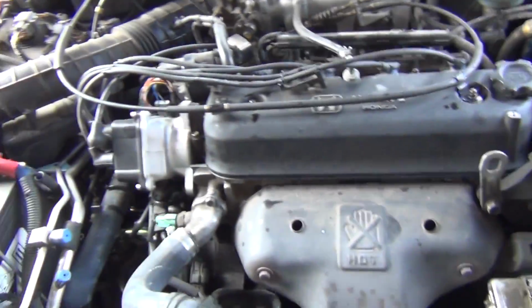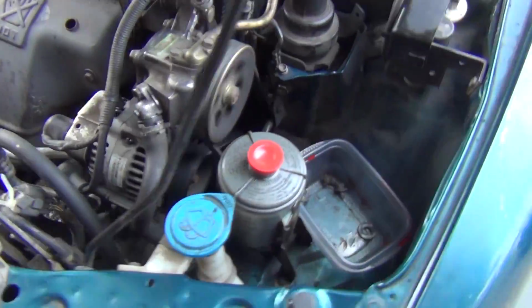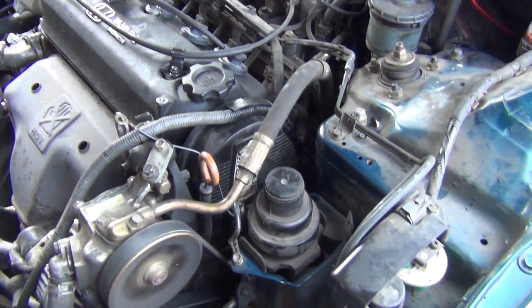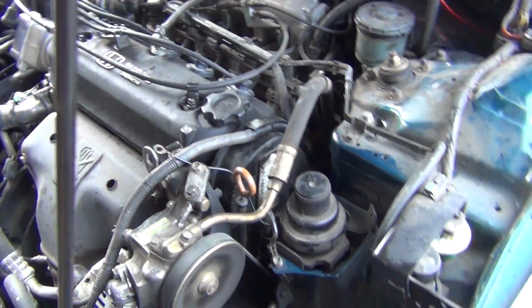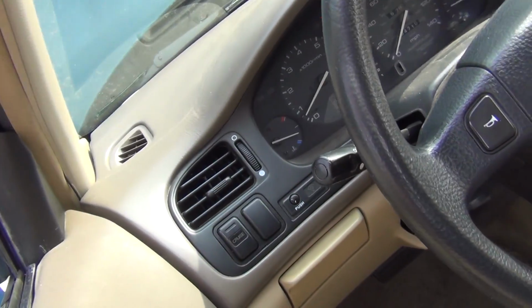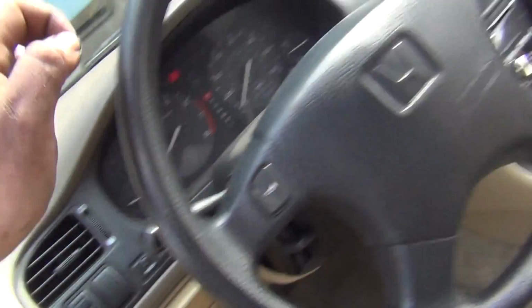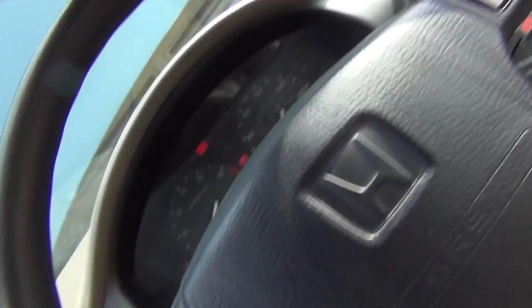Yeah, I took the valve cover all the way out. Set it on the bench, and I just pressed the gasket in, got it worked in, and then just gently weighted over here and flopped it on. So yeah, brand new belts here, brand new balance shaft and oil pump and timing belt. That actually went pretty easily. She sounds good, it's not overheating. Oh yeah, heater's working.